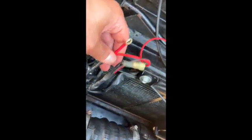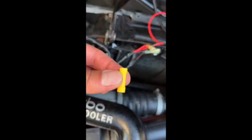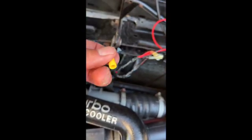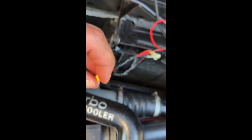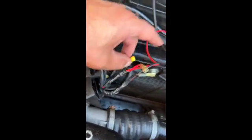Okay, this is what's happened. I've put these two wires together — I cut the wires from the radiator temperature switch, then got my extra wires and added them in using little crimpers. I popped wires in either end: two wires in the top one — one from the engine going in, one wire going to the connector to the radiator switch, and the other wire is the extra wire going across to the manual switch — and the same for the other one. I've taped them all up because I'm not overly confident in the crimpers. When I get more time I'll probably solder them properly, but I just wanted to check in principle that this works.